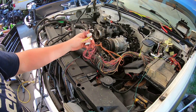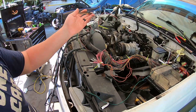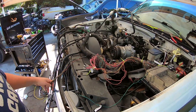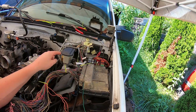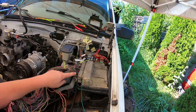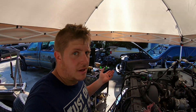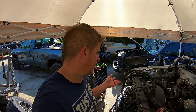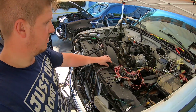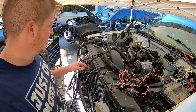So I'm going to get that put back in tomorrow morning, then I'll have to connect my powers to the sub-harness, get my TAC module wired and plugged in, and then get all my wires from the 99 harness pinned into the ECM/PCM connectors. Then we should be ready for a first start attempt. Just for perspective - from where I started on this harness this morning, which was pulling out the last few circuits I didn't need, to this finished state.